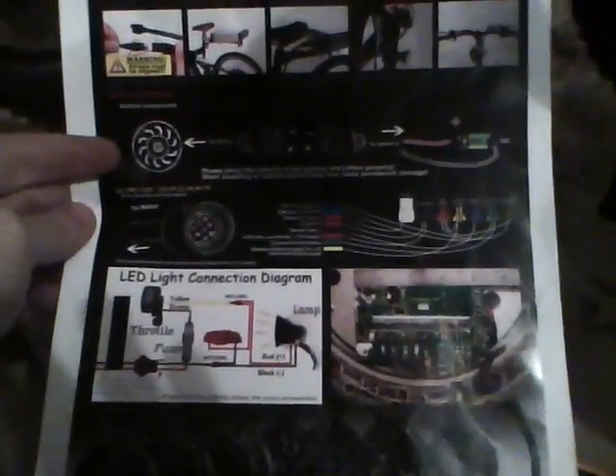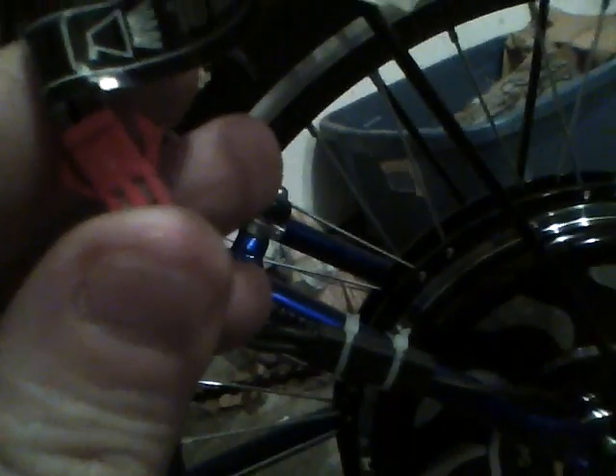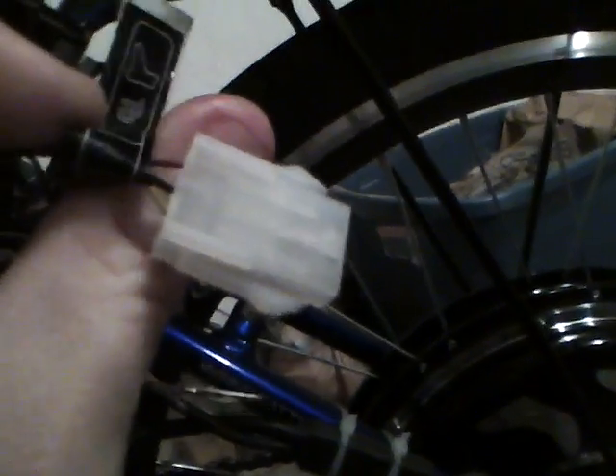This diagram implies that the feed for the lights would be five volts — I don't know if you can read this, but it says five-volt supply. But that red connector clearly marked for two LED lights — there's 48 volts, I'm seeing 54 volts coming out of it right now with a full battery. I mean, I'm lucky I didn't vaporize the plug.